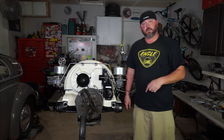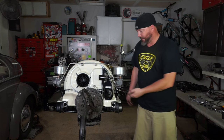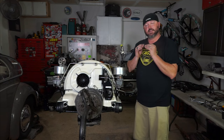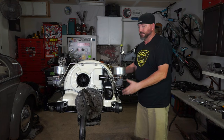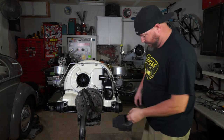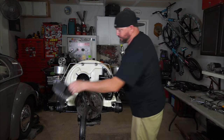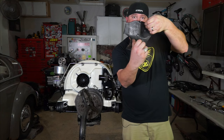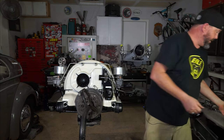Looking at the back of the motor, we need to address the sled tins that go underneath to protect the push rods and help direct air toward the back of the car while driving. All the air coming through the shroud comes down through the head tins, gets separated by the plate inside, goes around the heads through the fins, and the sled tins give it a direction to exit rather than just sitting there recirculating at idle. This is what a stock head tin looks like — it bolts to the back. But when you're running a header, you can't run these stock tins.